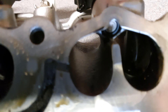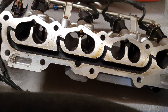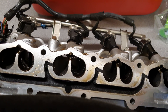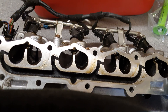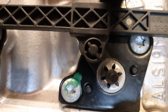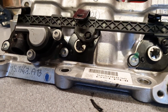The twin port design is now a little bit obvious — this is why this engine is called a twin port engine, because there are two ports here. Inside there's a little butterfly valve, and under normal running conditions this is closed — there's a vacuum valve on the end and it's sucked closed. Under load these ports open to allow extra fuel in, so under idle they should be shut and under load they should be open. A common fault with these is the mechanism and the joints — each one has a little plastic bearing ball joint that connects and when this rod actuates it opens and closes the valves.